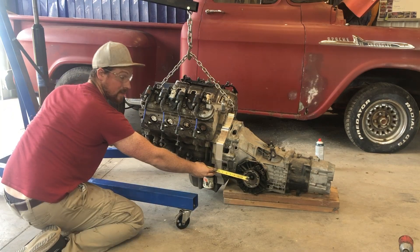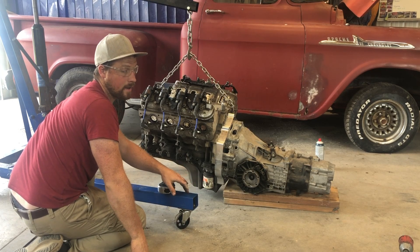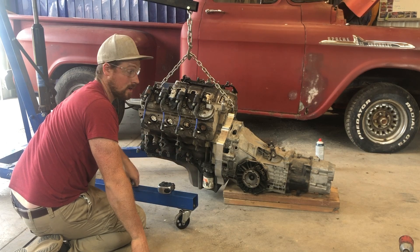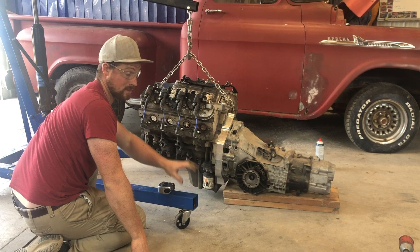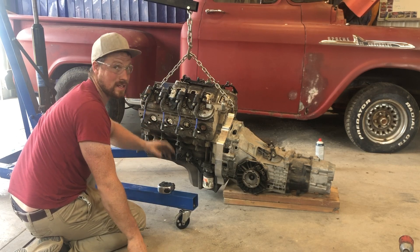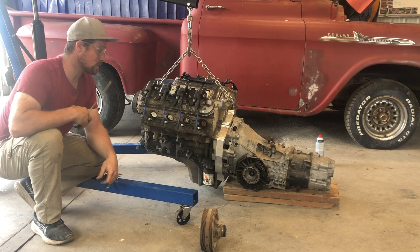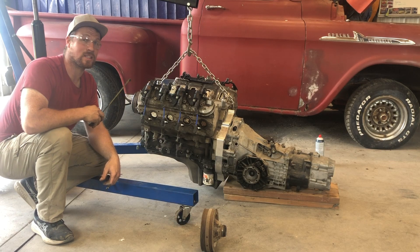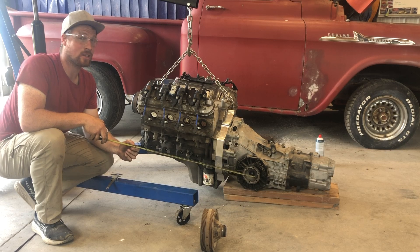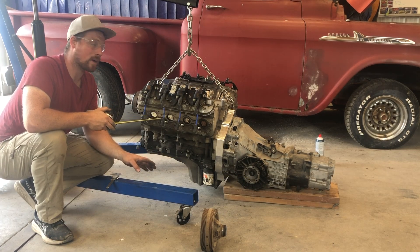This is what I've been waiting to find out: it is 33 inches to the front of the crankshaft. Now we've got to decide — do we want to go with the car LS accessory drive, the truck accessory drive, or be really fancy and go with the LS4 front-wheel drive accessory drive? Any of those three options. The LS4 is the shortest by far — we'd actually have to cut a bit of the crank off the front. I have truck stuff here, so let's measure that first — it's also the biggest. That comes out to 37 inches. We may need to give some effort to the LS4 accessory drive. You can also cheat these an inch rearward of the center line of your rear axle. We'll go back to the Chevette, do a little research, and make our choices from there.